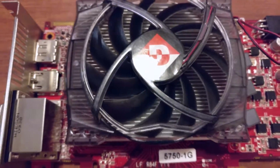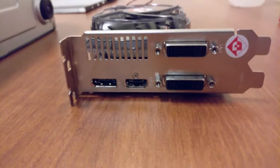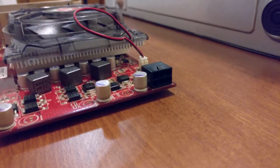You'll want to make sure that your graphics card isn't so long that it doesn't fit into your case, and you'll want to also make sure that your case has enough available expansion slots to fit your desired graphics card. When it comes to data transmission on these cards, virtually every card is attached over the 16-lane PCIe standard bus now, so that's basically a non-issue for you.